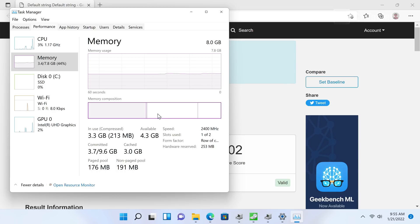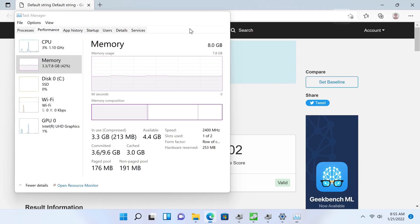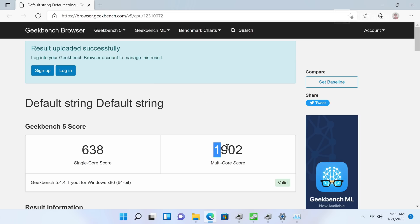The RAM isn't running at the full supported 2933MHz — it's at 2.4GHz, a little slower. I've confirmed with HWiNFO that it's in single-channel configuration. Dual channel would give more memory bandwidth and improve performance significantly. The multi-core score for the 10-watt part is still good, but dual-channel RAM would push it over 2000 points, gaining around 200 more.